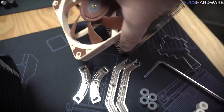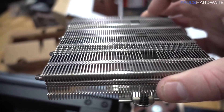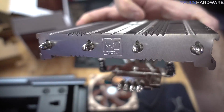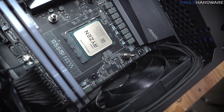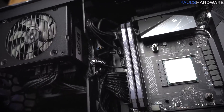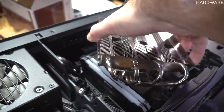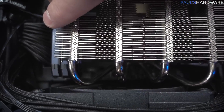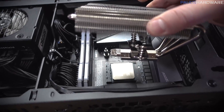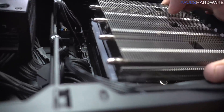Then I realized there are two different sets of mounting brackets for this cooler — horizontal or vertical — depending on which way you want the fin stacks to go. You'd want the fin stacks oriented so air flows across them better. At first I thought vertical would be ideal given the intake at the bottom, but then I noticed a fan here acting as an exhaust and the compartment being somewhat separate from the bottom anyway. Then I started positioning it and realized the tall Corsair RAM conflicted with the heat pipes in one orientation, and the end of the cooler conflicted with the fan in another. The only way it fits is a specific orientation — I even had to bend the heat pipes just slightly to clear the Corsair RAM.